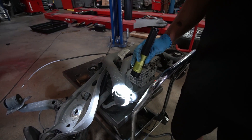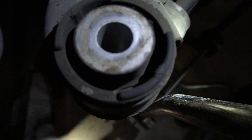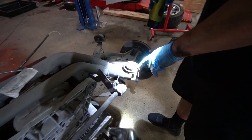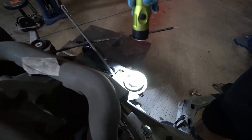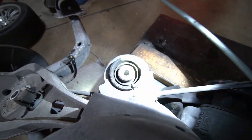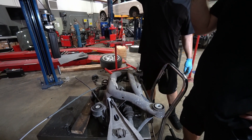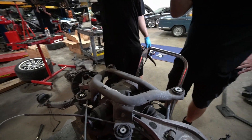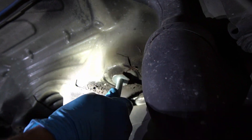Make sure you get this on video — these look like cracked rubber bushings from the subframe. Some of them are okay, but that one is not. Originally I wasn't going to order subframe bushings because I thought I wouldn't have to replace them, but luckily we ended up getting some poly subframe bushings. It's completely loose — not completely, but it's pretty bad.